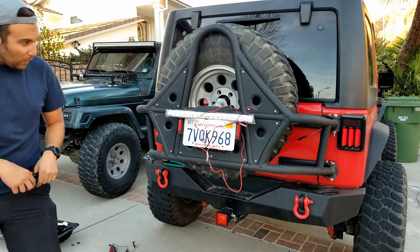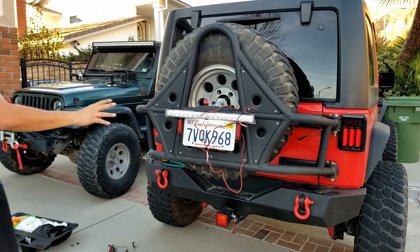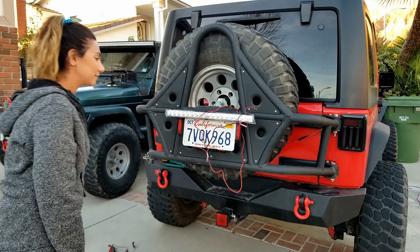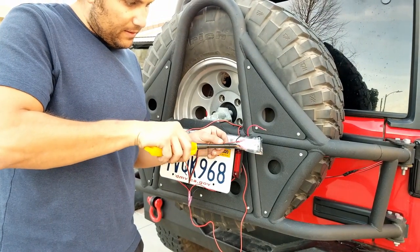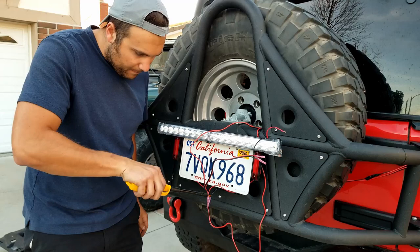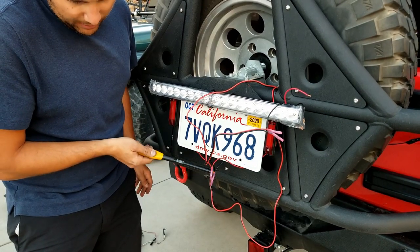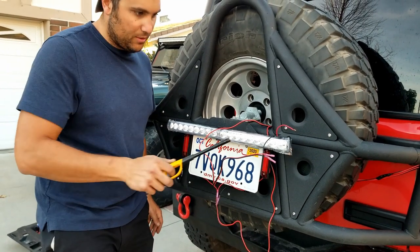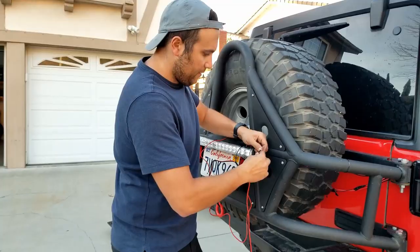And there it is — wow, that looks incredible! Using a torch lighter, I'm heat shrinking the crimp connector to make it more waterproof. This stuff actually shrinks quite a bit. I'll drop the link for this torch lighter — we got it on Amazon, it's amazing. We're going to double duty it with electrical tape as well, finishing it off. And now we are in business. The wiring is Auline's department now — she has to wire it through everything.